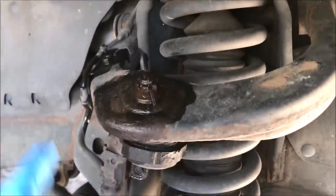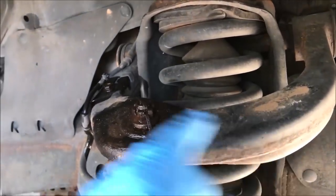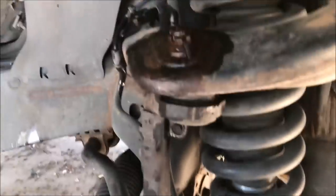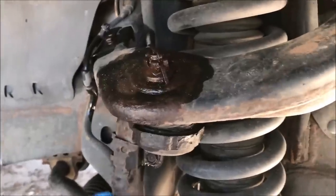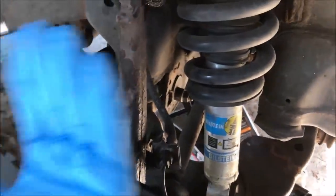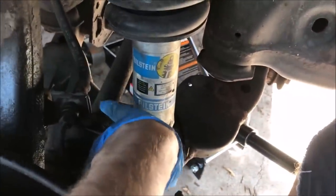And since we're going to take this upper control arm off anyway, now's a great time to just take this bolt out and take this spindle out. But when we do that, this whole wheel spindle is going to shift this way, it's going to wobble this way and back and forth in every which way, and this axle, you even risk pulling that out.